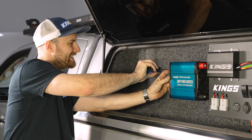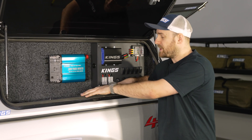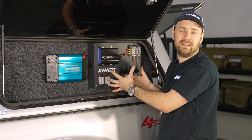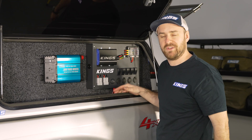With the unit installed, the next thing you need to think about is your wiring. Because the battery in this setup is underneath this shelf, I'm going to need to feed the wires down to it, and that's going to mean extending those wires — which is a good thing because I intended to add that 50 amp fuse anyway.